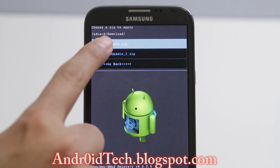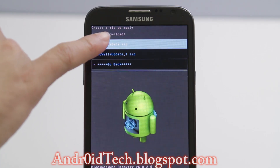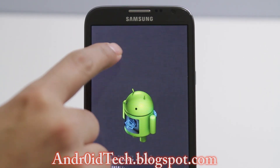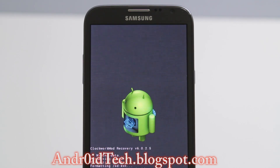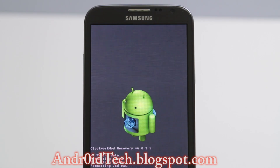Select the Novela Beta ROM, which is part of the Alliance ROM family. The file labeled '1' is the first upload — flash this one first. Hit yes. This ROM has a themed System UI plus Phone UI. Phone UI means the phone application user interface; System UI means the pull-down notification menu.